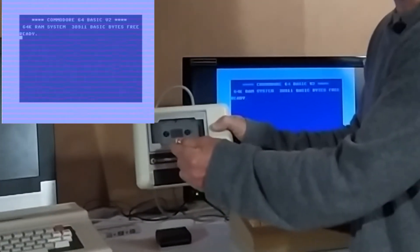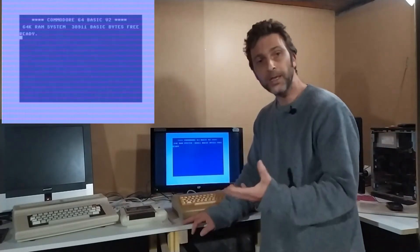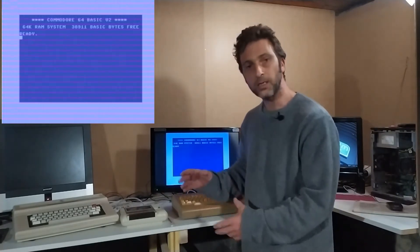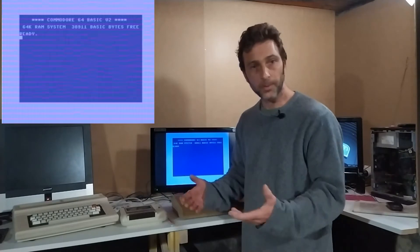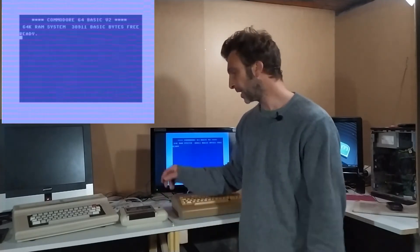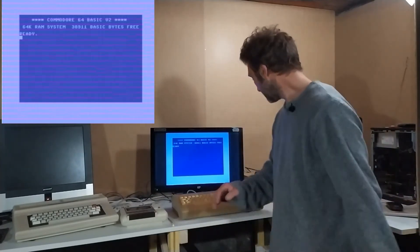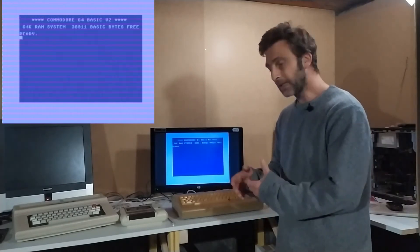You can make the azimuth tighter or looser that way, but unless we have a visual representation of whether we're making it better or worse, we don't really know what we're doing. Thankfully there are programs written for the Commodore 64 that show us on screen whether we're aligning it correctly. To load these up you can use the data cassette, although that may be problematic if the azimuth is way off. You can also use a Kung Fu Flash cartridge or similar. Today I'm using my 1541 disk drive since I haven't used it in a while — I'll load up the little program and show you how it works.